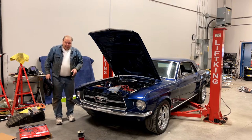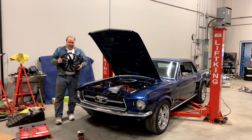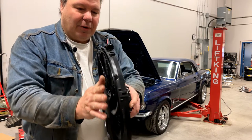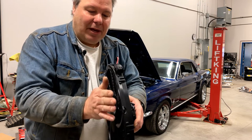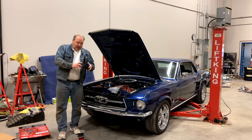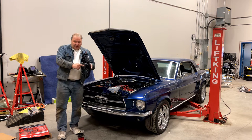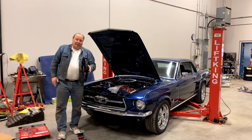We should have lots of clearance — it's a stock type radiator — and then we're going to mount this on there. There are a couple of things you've got to look for when mounting a fan like this. Lots of times these fans have some play. If you look at it edge on, you'll see that the part of the fan that rotates is pretty well flush or even protrudes inboard slightly from the housing or shroud. Because of that, you have to be cautious and maintain clearance between the shroud and the radiator, otherwise the fan can bore a hole in the radiator core.